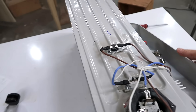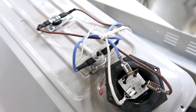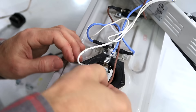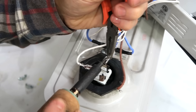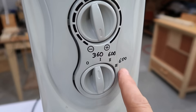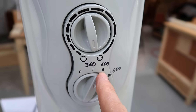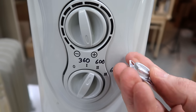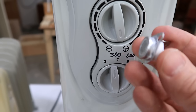Opening up the other one, I'm delighted to see this one has a second cutout thermostat that cuts off power entirely, but it looks like it has a little button on it — meaning if the second thermostat trips because it got overheated with blankets or something, you have to open it up and push this button, which most people never would. Oh no, this one's soldered on. I got the new power levels marked on here. A slight correction: the way it was before, if this is set to level 2 only the high power element is used, which the overheat thermostat will eventually shut off, and then the overheat thermostat cycles on and off — not good because these don't last forever. Better to use level 3 than level 2, because level 3 is essentially level 1 once the overheat kicks in and it stays kicked in.